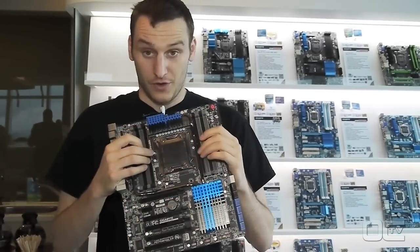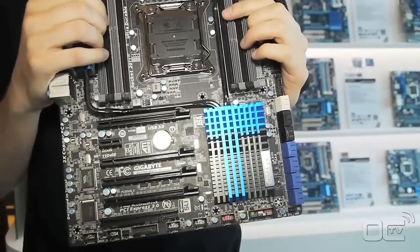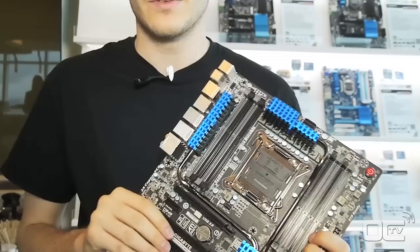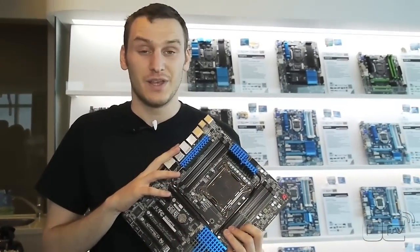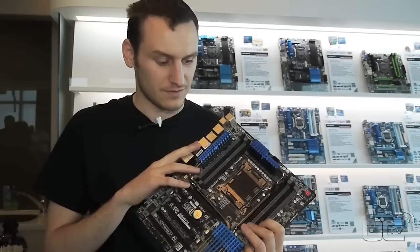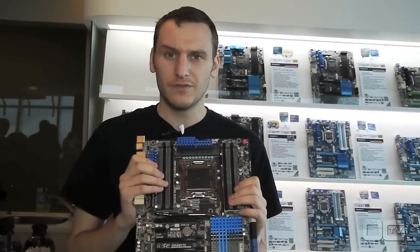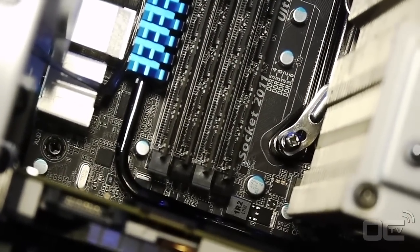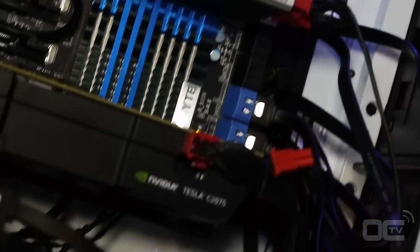You will get back the 2x4 lanes of memory, so you can plug a lot of memory inside — you can have 32 gigabytes. The mainboard also supports the Xeon, the server Xeon, that fits on the LGA2011 socket. So you can even put ECC memory on it, and with ECC you can find higher density sticks, so you can go even higher than 32 gigs in the end.